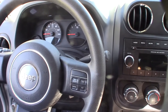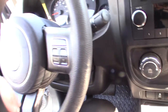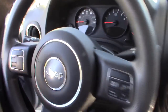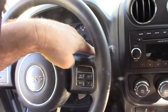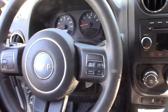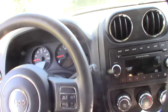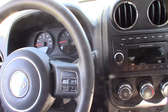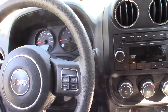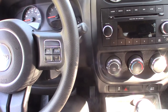I've actually had quite a few issues with this area — I think there was a water spill up here, because in one of my other videos I had a bad turn signal indicator. Because the windshield wipers go through it, anytime you'd do the turn signal it would actually trigger the windshield wipers. So there's a lot going on up here — multiple errors — and the airbag warning is intermittent, comes on and off.